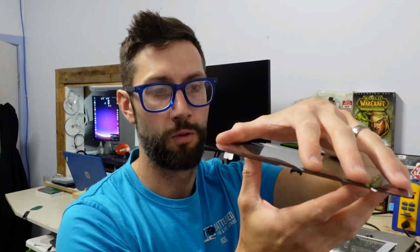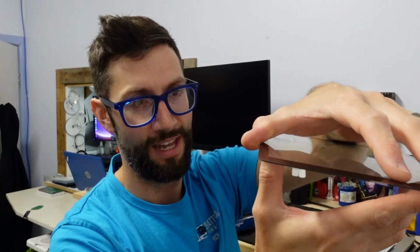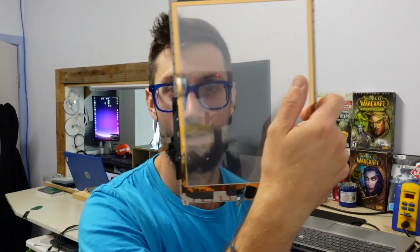So if it's not glued down well enough or it's on bare metal, you may cause phantom presses or inaccurate readings or whatever you want to call it. Basically it stuffs up. With that foam on the board, it's slightly lifted up a bit higher, and that reduces another point of failure. So what the more premium one's doing, even though it mightn't be one certain thing that gives it the advantage, the combination of them makes them a hell of a lot more reliable, and I'm going to trust them considerably more than ones like this.